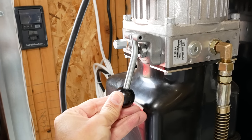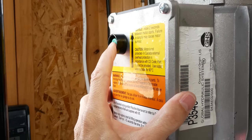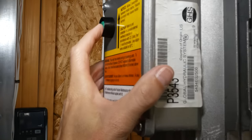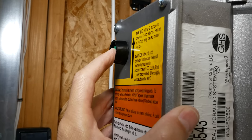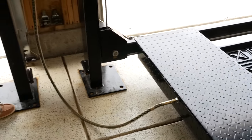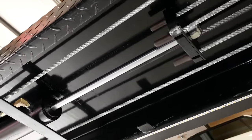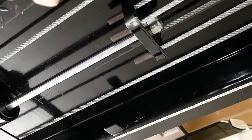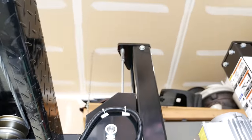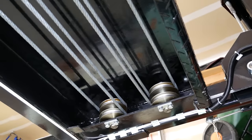Operation of the lift is actually pretty simple. This lowers the lift by bleeding off the pressure, and this little green button up here is the electric start for the motor. So we just push that and that's all we have to do. As you can see, the lift is starting to rise — it pulls this ram here back. The cables are all running through pulleys here and end up at the top, so it literally pulls on the cables and lifts itself up.